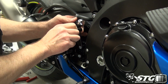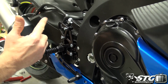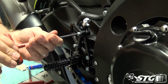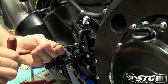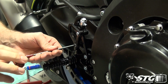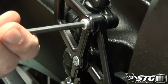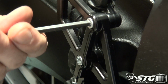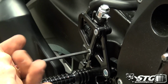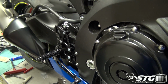Now we've got our master cylinder mounting bolts. If you've chosen to use Loctite, okay, this is another great place to do that. Run both of those down. These will accept adequate torque. Pretty good sized fasteners. Like so, and I like how those are recessed in there too, like this right here, very, very clean.